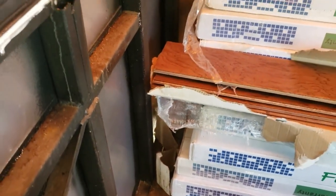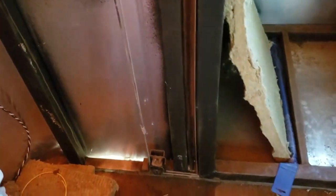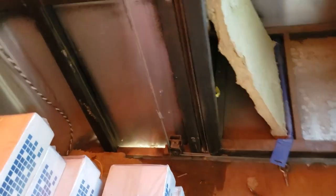That has to be pulled in — it's out about three quarters of an inch or so. It has to be tight before I put the spray foam in, because the foam doesn't flex at all. If I don't do it now and go ahead and skin it, that's where it's going to stay. So I'm going to skin the bottom with stainless, get it riveted in there, and then the inside will be ready to spray foam — probably not until the middle of April.